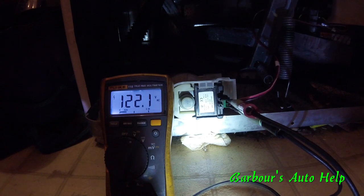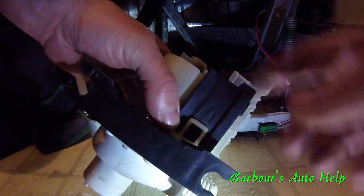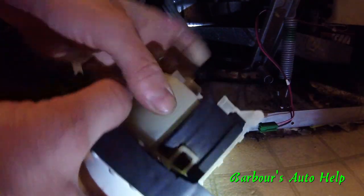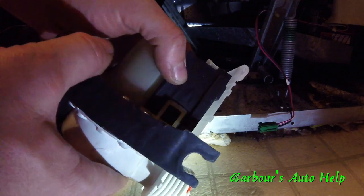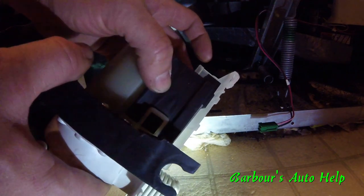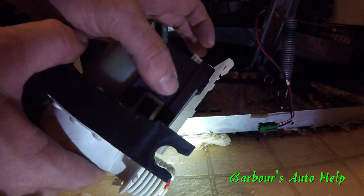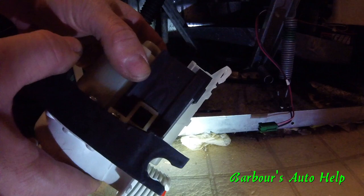It's actually working but it sure is noisy, and it's dropping 120 volts — so we're going to go ahead and replace it. My theory is that whenever this thing had water going through it, it was getting loaded up, and with power going to it, it was probably overheating those coils — either short-circuiting them or causing them to open — and that's why it would quit working.